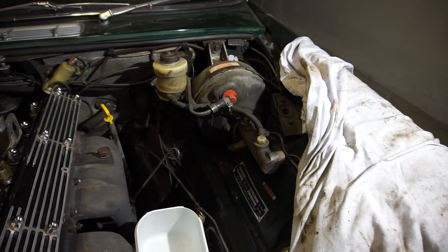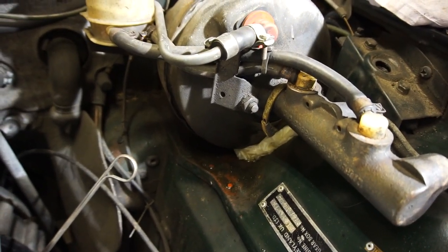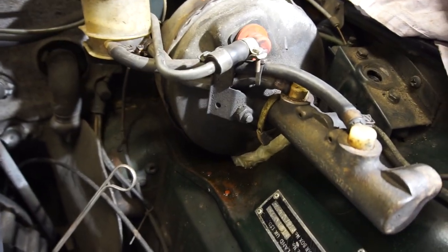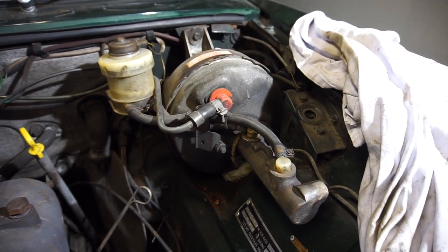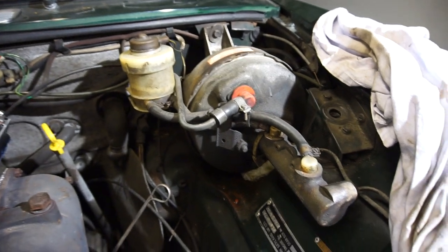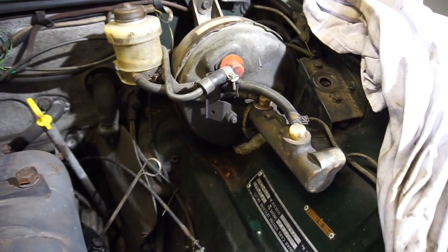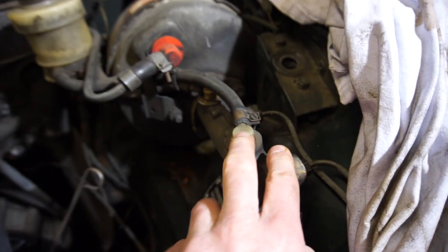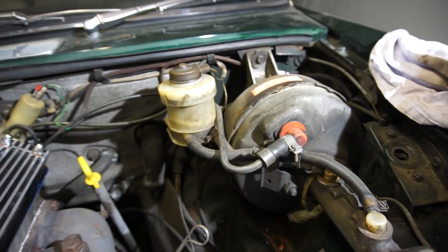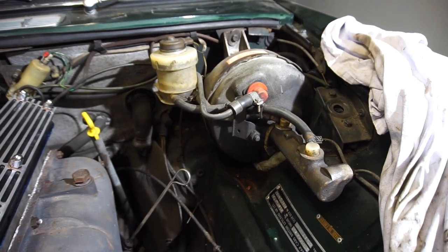Let's go over to the car and I'll show you where the leak is. We'll take everything off, go over to my workbench, and I'll show you how to rebuild it. Here's the leaky master cylinder — it's been leaking down there at the back, running down by the servo. I put some paper down there just to catch the leak. The reservoir is pretty much empty. My plan is to remove everything as a unit — just leave the servo there but take the reservoir, the hoses, and the master cylinder out as one unit, so I can get the hoses off more carefully and try not to make any mess. I'm going to cut those off carefully. They're all rusted. I don't want to break any of the plastic fasteners here or the reservoir, because that seems to be one piece and not broken.